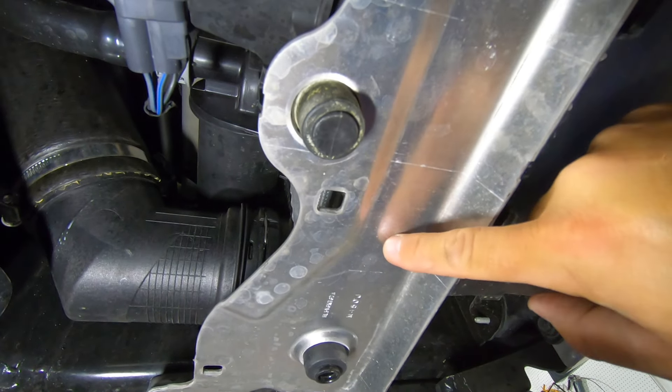So now we've got our factory intercooler and our CV intercooler. Right off the bat, you can see a huge size difference. It's also a different type — fin and plate versus fin and tube — which is going to give a little bit more heat exchanging capability out of the CV one. Heat transfer is a function of surface area, so every opportunity to increase surface area improves intercooler efficiency. You also get a drain plug on the CV intercooler in case you need to evacuate any moisture.